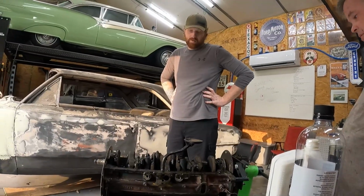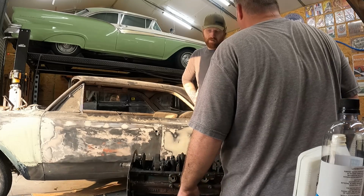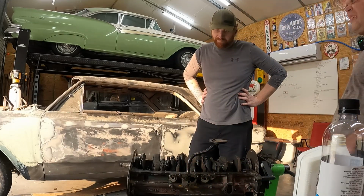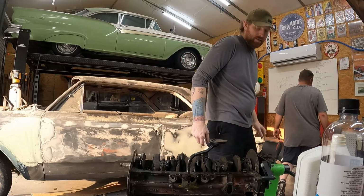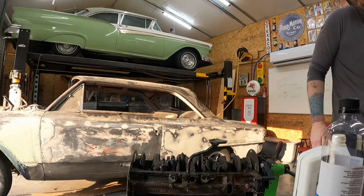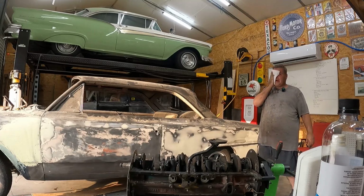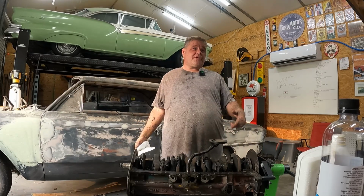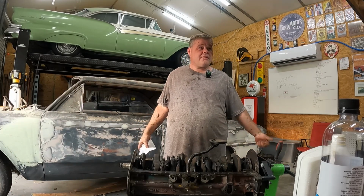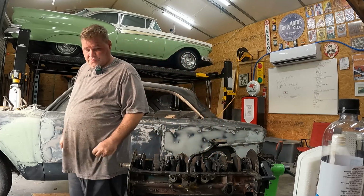And now we gotta get oil into all of those little lifters with the towel. And we gotta wipe the cylinders. Do you want to? We don't have to soak those. No, they're solid. That's what I'm saying. We can put in the cam with assembly lube. That way the cam bearings. Yeah, we can do that now. Get that out of the way.